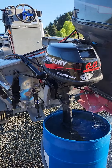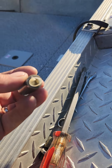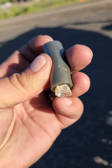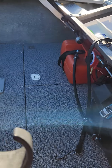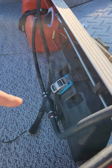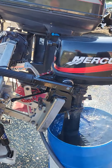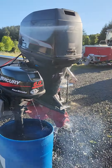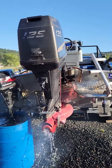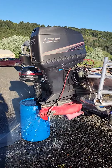On this little Mercury, I replaced the fuel line because the old gray fuel line was coming apart in pieces. I replaced the fuel line from the gas tank to the engine, replaced the primer bulb, and replaced the inline fuel filter. I also adjusted the idle on it because the idle was super crazy high.